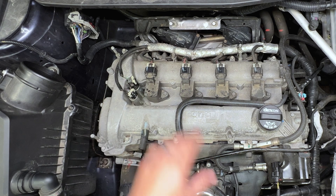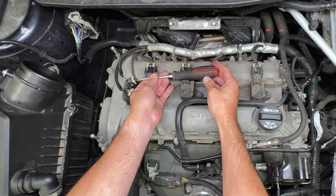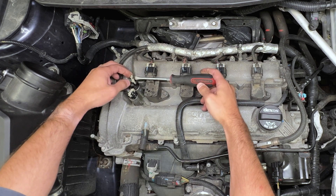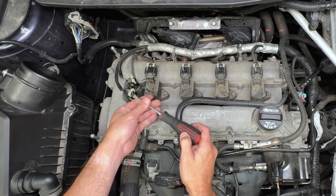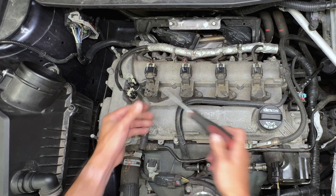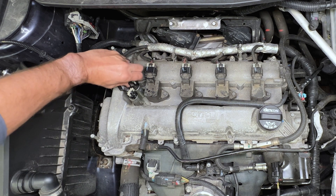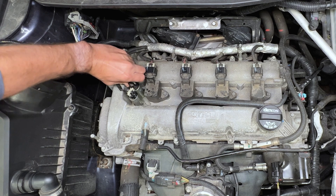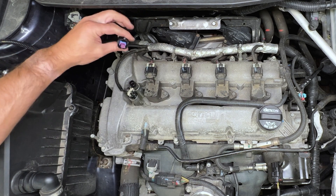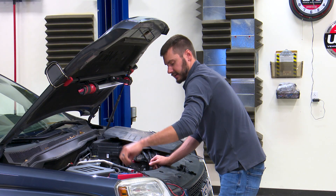To be able to test these, we're going to go ahead and unplug the connector. Take our flat blade screwdriver and very gently raise up the locking tab. We'll do the intake side right away — very gently moving up that locking tab and pressing in on the detent. We'll unplug our connector nicely. We'll get that harness out of the way and do our resistance test.